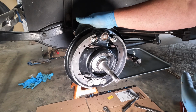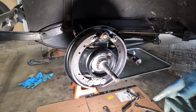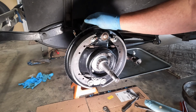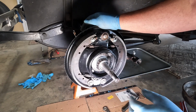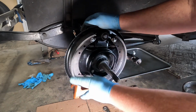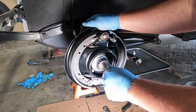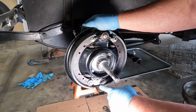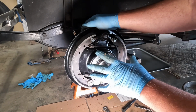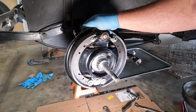And so I'm electing to do this similar to the way I've done many a drum brake on more modern cars. What I plan on doing, and what I've actually done, is I put the drum on without packing the wheel bearings. Just put the drum on, put the bearings in, put a preload on like I normally would, spin the drum, and click the adjuster back here until I hear slight tension on that. I believe that the equalizing cam down here for the wedge is going to be sufficient enough to give me good brake stopping. And so that's the way I plan on doing it.